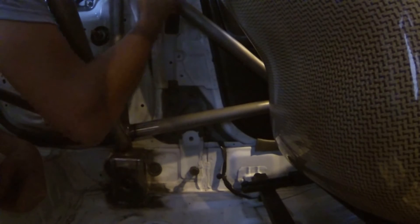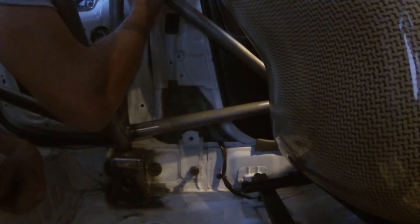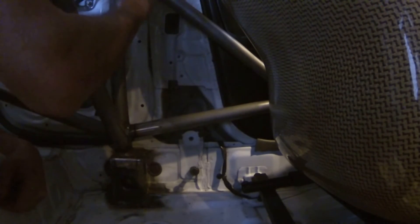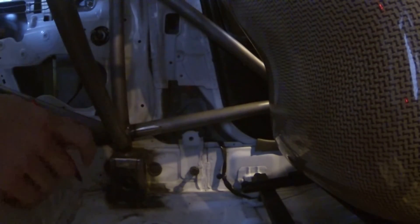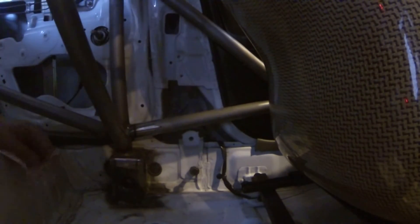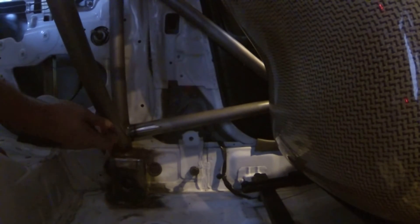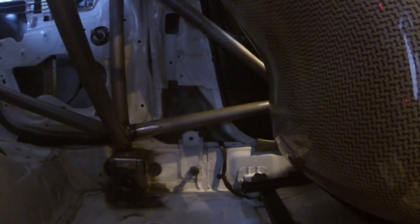On the door bars, I typically like to go just on the insides — nothing really fancy, just a few inches away from where the weld is. We'll toss one in there, one in there, and do the exact same thing on the other side. On the diagonal bars, there's lots of space underneath, so anywhere between 5 and 7 inches from the weld, we'll put one on the bottom. We'll do the exact same thing on the opposite side so it's completely mirrored and easy to remember.